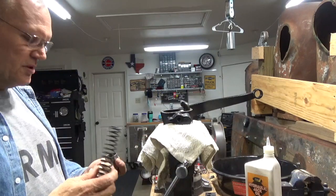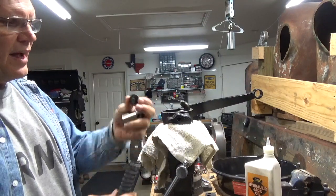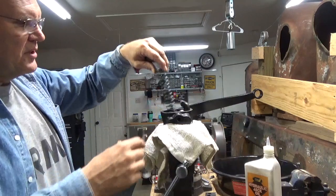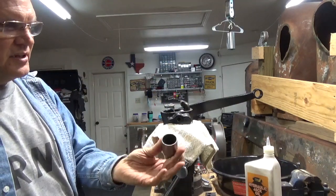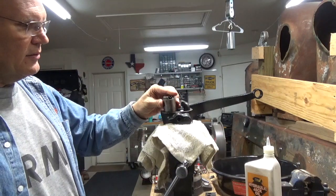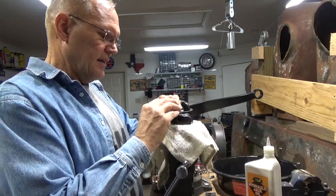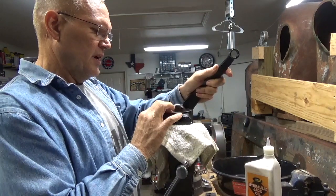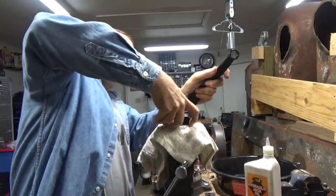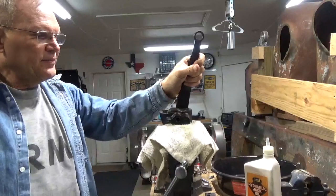So we'll take our piston spring, our intake valve assembly, and we'll set that on the piston spring. I'm going to set that inside of here. Then I'll take my piston itself, slide that over. And then what we'll do is go ahead and press this down. Rotate the lever arm over. Go ahead and press that down.